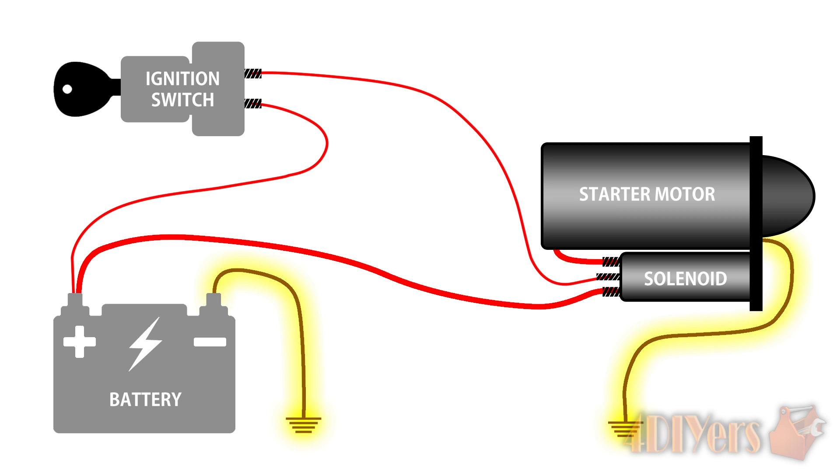The case of the starter motor assembly is ground or earth. When the ignition switch is turned to the spring-loaded start position, this activates the solenoid that provides mechanical movement and in turn also switches the high amperage circuit, providing power to the motor. The motor then rotates. Once the spring-loaded start position is deactivated, everything pulls back into its neutral position.